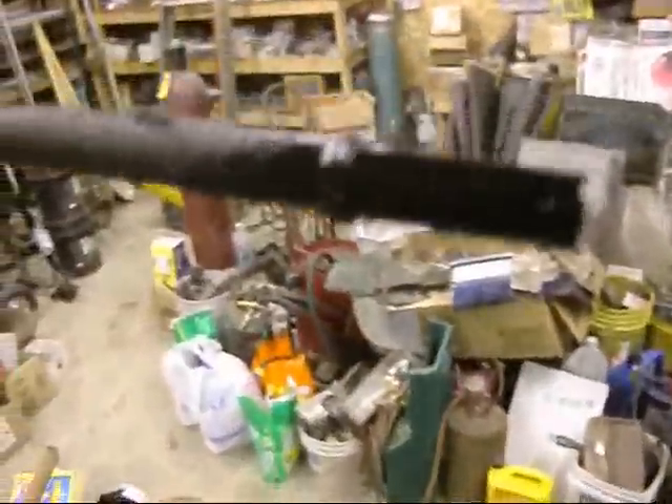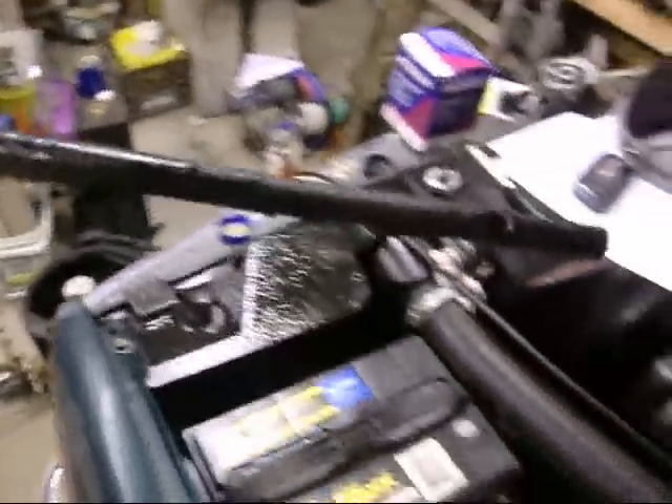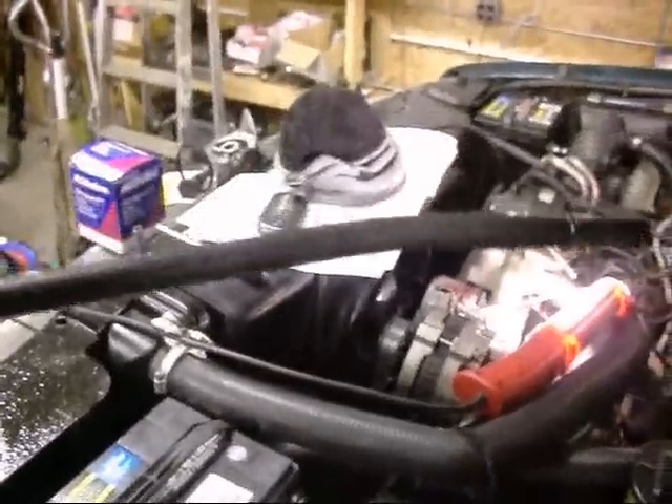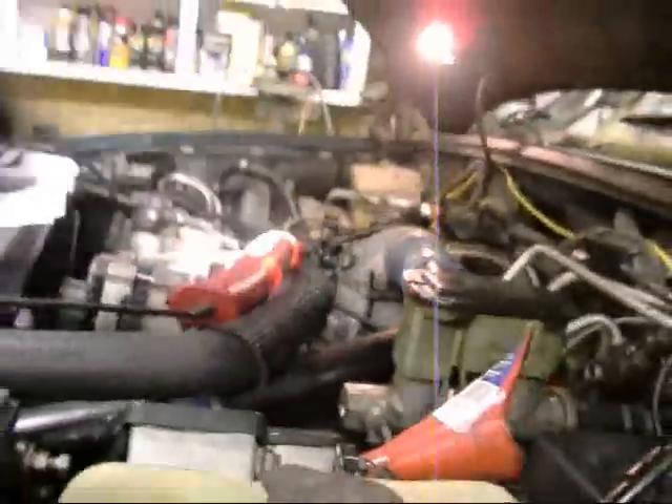There's the dipstick, and the tube is right behind it. I don't have the O-ring that GM specifies, but anything's got to be better than what's on there now. And the O-ring stayed inside the oil pan - I've got to pick it out. The tube is not rusted. Usually dipstick tubes leak when they rust away - I've seen them rust right off. I had an S10 years ago that I bought cheap at high miles and the dipstick was rusted into the engine; I had to cut the tube at the top to pull it out, just shortened everything by a few inches.